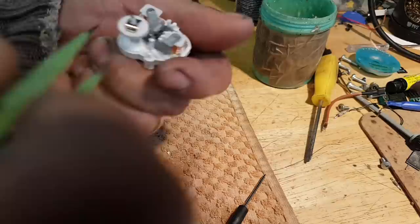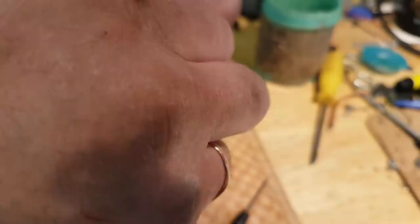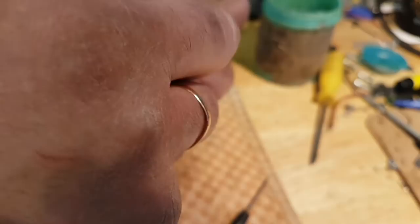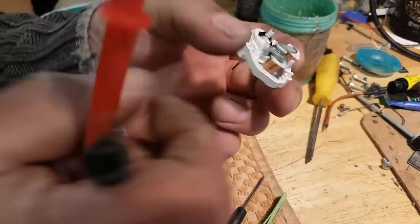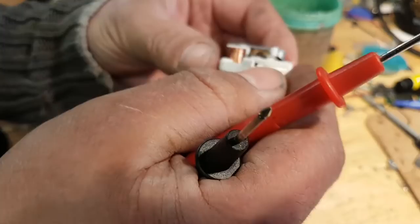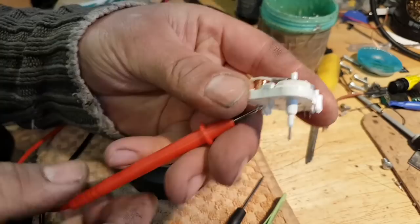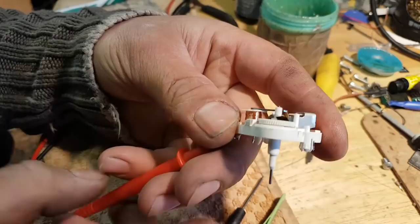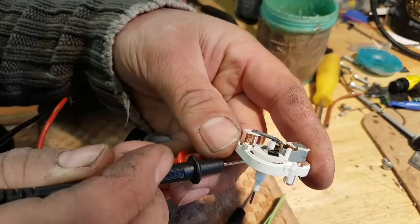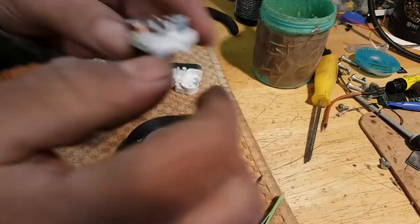When I put these here, when I touch the coil that was faulty with about 5 volts, I would say that should just jog a little bit. Not moving too much, but it should jog. So let's kind of look at the cog, all of us, and see what happens. Oh, you seen that? Oh dear, let me reverse the polarity and now it should move again a little bit. Yes, he moved. He did move.